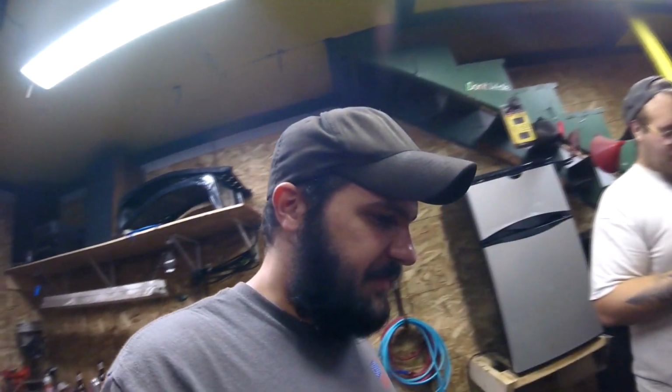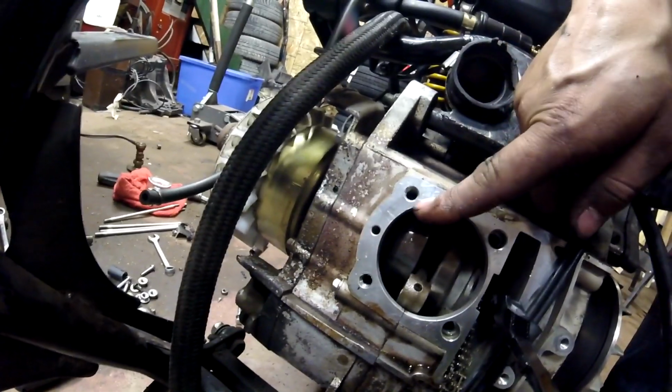But anyways, thanks for watching the teardown, guys. Hopefully you enjoyed this little scooter content. We're going to figure out a way to Dremel that out, because I'm not pulling the crank out of this thing because I don't really want to. I could pull the crank out and then go get a hole saw or something and cut it. But there's not a lot of room between where the studs go into the case and how far we've got to Dremel it. If you guys can see down here, these are the bolts where the studs go that hold the cylinder down to the case, and there's really not a lot of meat.